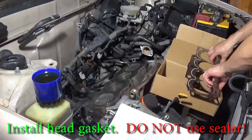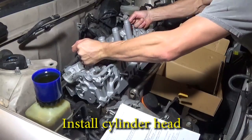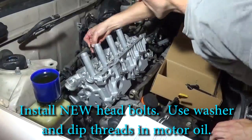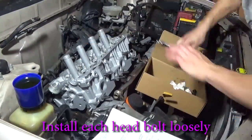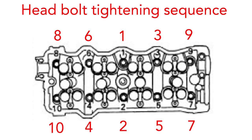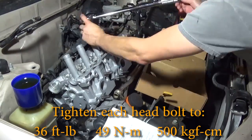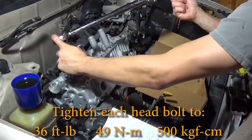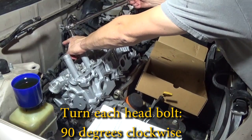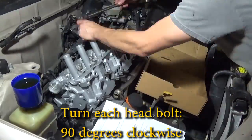Can't have any oil on that head gasket. With everything very clean, put the head gasket on the engine — make sure you do not use any kind of sealer. Place the head on the block, lube every bolt with oil, and install the bolts into place. This is taken from the engine service manual. Torque each bolt to 36 foot-pounds. Next, we're going to turn each head bolt 90 degrees. Tighten them in the order specified by the manual — go back to that part of the video if you need to.